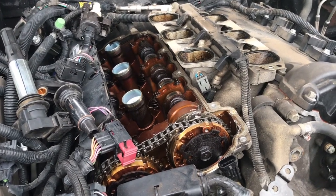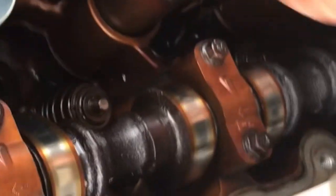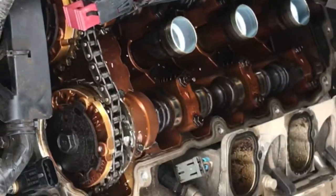What we're going to do here is pull out a couple of the broken pieces as little keepsakes so that he can decide what to do with them later. These are the little rockers off the intake cam on the right side — bank one. Some of them are somewhat damaged; some are broken up. This one here, the bearing is missing at least one quarter of the piece. I wish I could get the ones that fell down in there — they're all bent up and mangled.